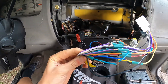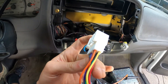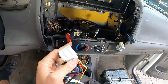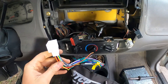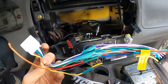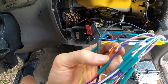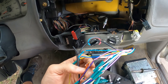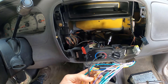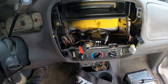All the wires have been matched up. This is a little jumper harness that you can get at AutoZone or any car stereo place. You want to make sure you get the one that matches up to your vehicle, and then once you get that you're basically good to go - you can match up the wires with the wires that come with the radio. I'm going to solder them all. I've had bad luck with crimp connectors in the past. Once I'm done I'll put heat shrinks over them and shrink them all. I always want to test these out beforehand by plugging in the radio and turning on the key while they're just twisted together, just to make sure everything works before you solder so you don't have to redo it.